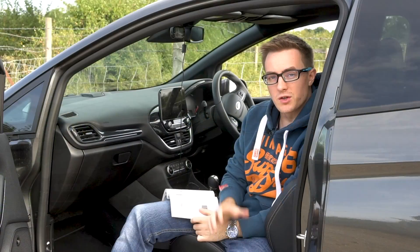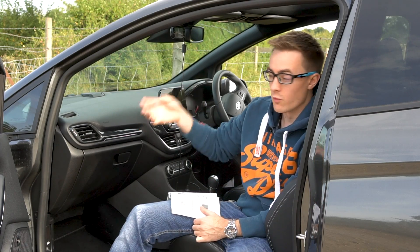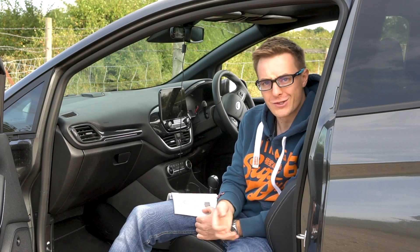Let's get into it. As part of step one, the first thing you need to do is wire it up as if it was hardwired, but without routing the wires and removing all your plastics. The reason for doing this is to ensure that you have everything you need to make it work and that it does actually work.